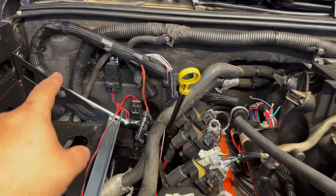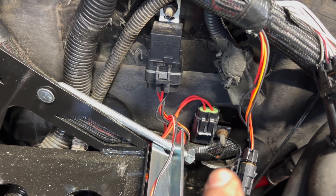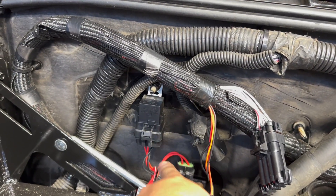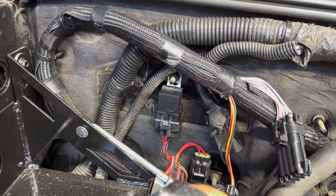I'm going to toss a little bit of touch-up paint around that hole that we just drilled. I have a grommet or a large gasket on order but it's not here yet. So in the meantime, we're not wasting any time — I'm going to go ahead and run these wires through and get them up into the glove box. As you guys can see, we have the cutout. I went ahead and mounted this relay to a ground, and then we have a fuse mounted just below that. I went ahead and mounted them there so that they are out of the way.